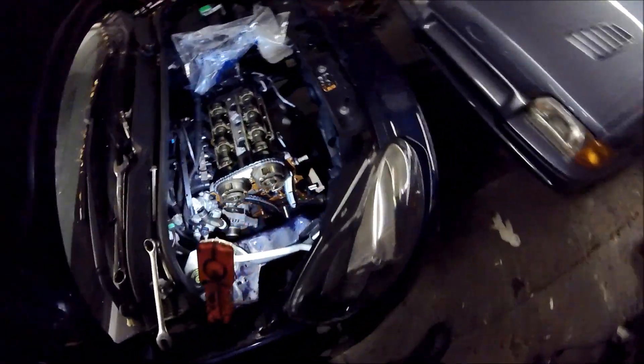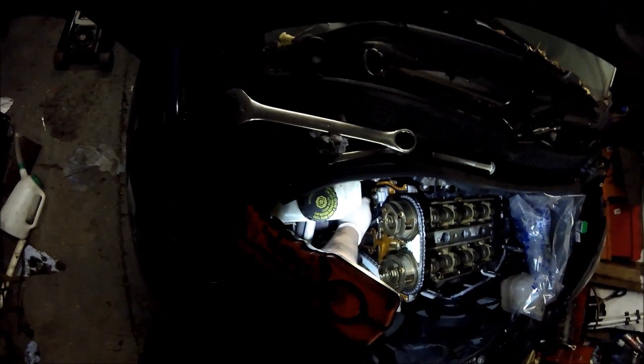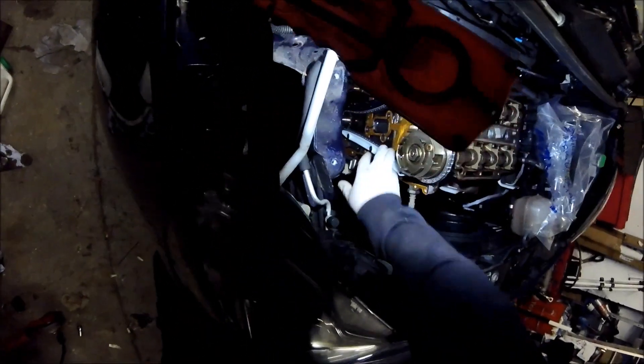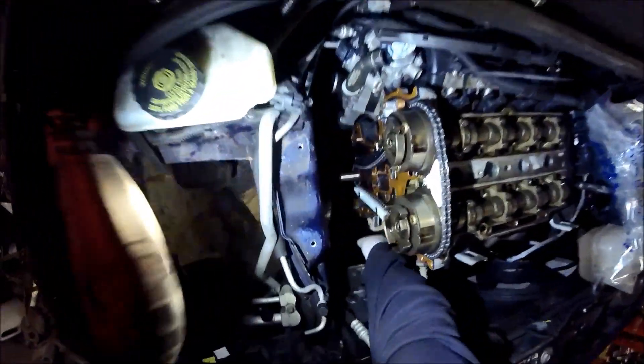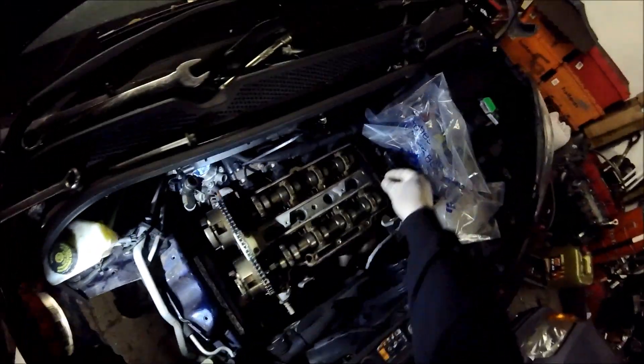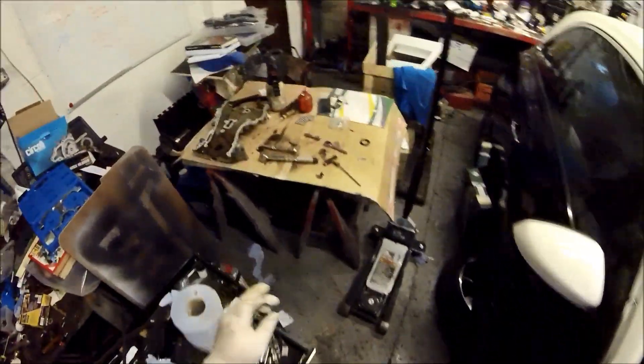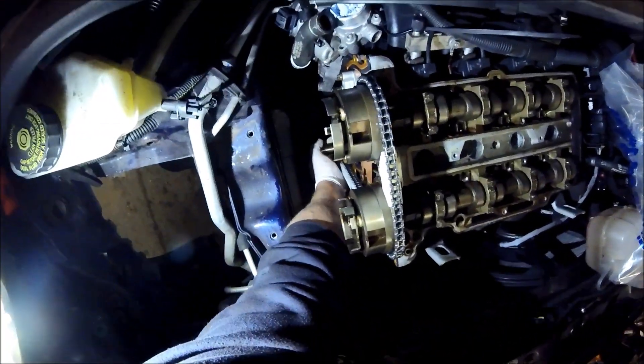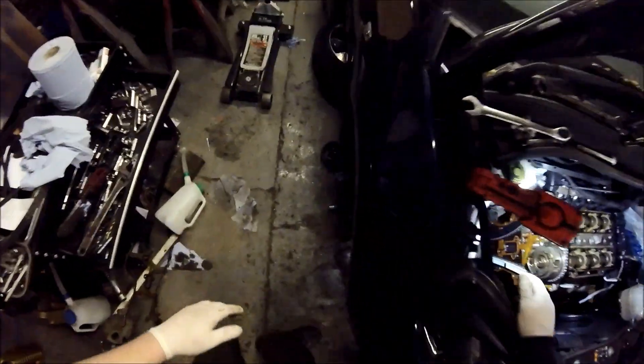All the chain is in the center of the runners. Grenade pin is holding, which loads the chain and takes out the free slack. Locking pin in the bottom, cam locking tool in the top — all good. Main crank gear is in place with the chain around it nicely.